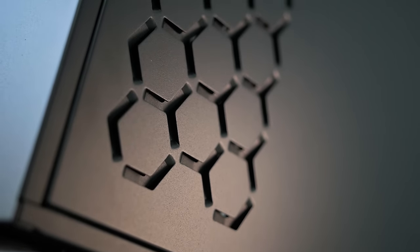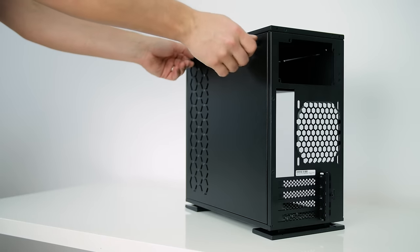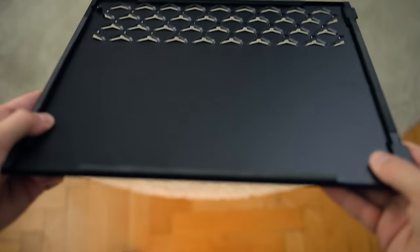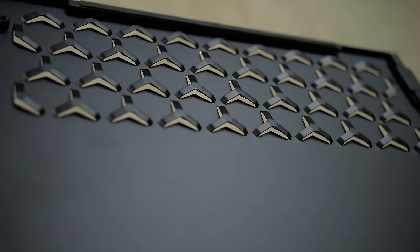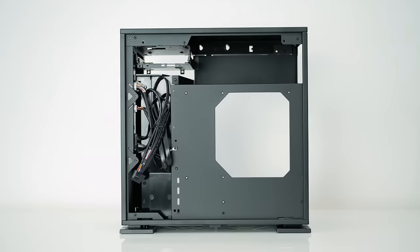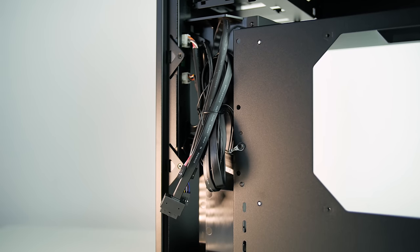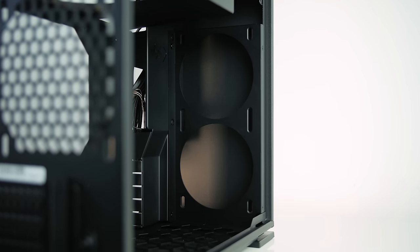You could light it up from the inside for this really cool illumination pattern. The side panel is held in with two captive thumbscrews, and while the design of this ventilation is cool, the spacing here is very limited. Plus there is no dust filter, and you guys know how I feel about that. On top of that, the side airflow entrance is very much blocked on the inside as well — you can see this area shares the space with cables. It's an odd airflow design.